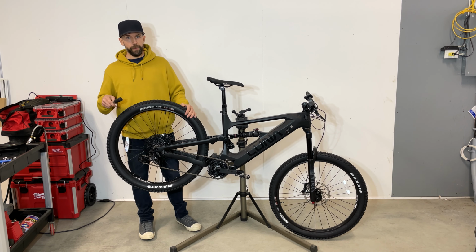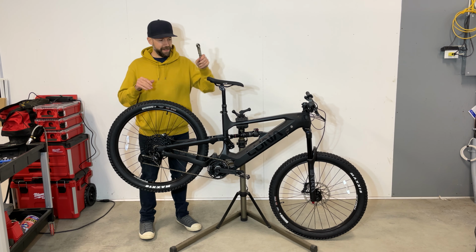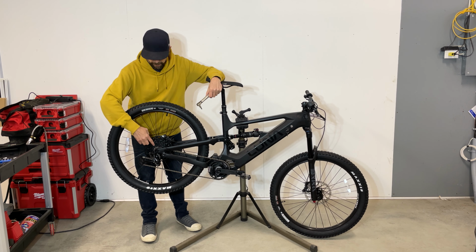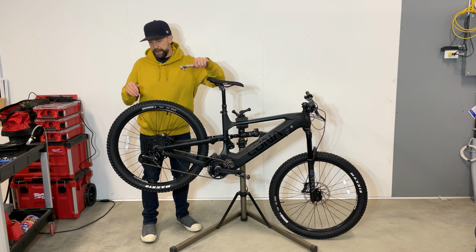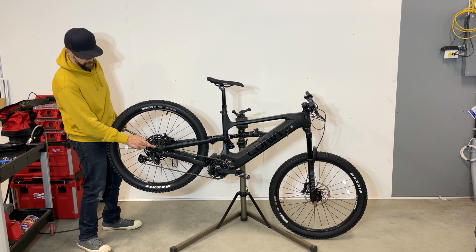You got a powerful motor. Chances are you'll try full throttle, full top speed on your first ride. And if the derailleur, for any reason, is not indexed properly, you can destroy the cassette, break a chain, take out the derailleur. So make sure all the gears are working fine. Make sure the hanger is also straight.